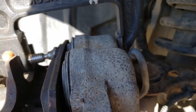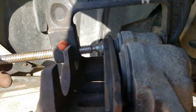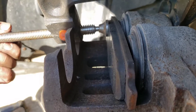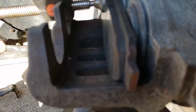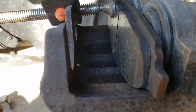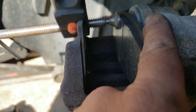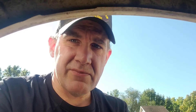A little trick if you need to get the pistons to move back in so you can put the new pads on: just put a C-clamp on with the old brake pad and screw it in. You can see the pistons going in. If you have a little fluid come out and see some drips from the reservoir, don't be alarmed — that's just pushing fluid back up. But remember before you take off to give your brakes a few pumps. I've forgotten that and had a wild ride.